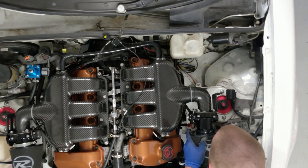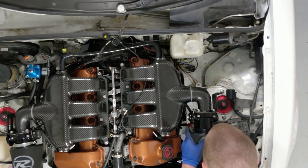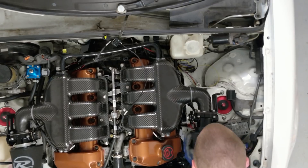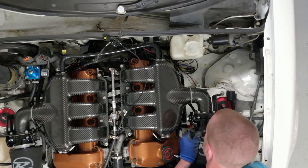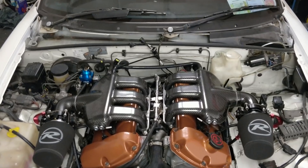There was also a hole drilled in the bottom of the air filter which is part of the PCV vacuum system, so it goes to the top of the valve covers. There is a standard connection there that is used on the Jaguar S type engine.